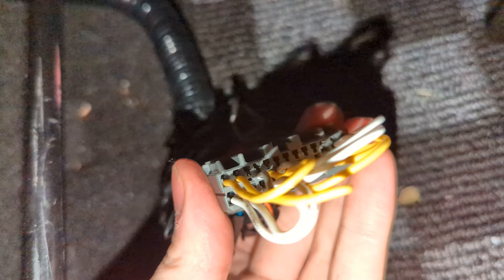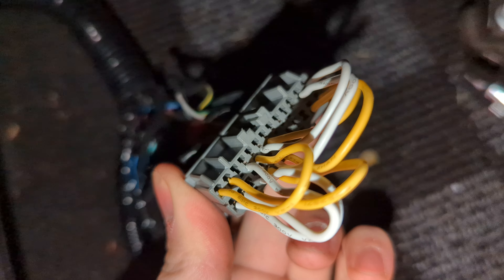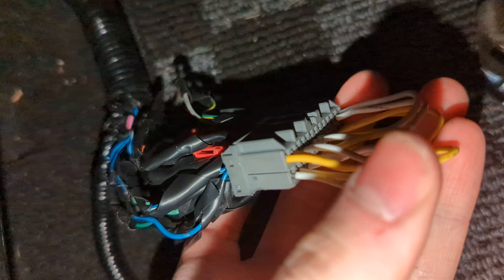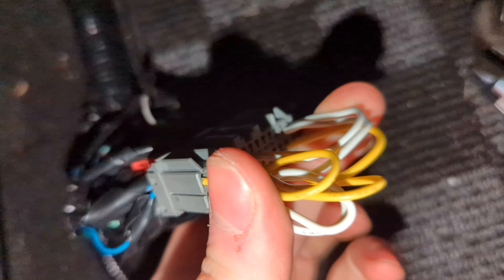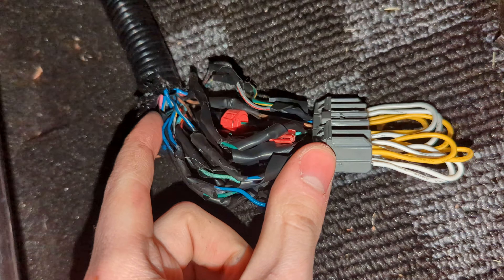It's under the seat — unplug your amp. I have 18-gauge solid core wire, and literally just stick it into the connector. 18-gauge solid core fits perfectly without moving. I'm pretty confident this isn't going to fall out. And boom — you can have your factory amp wiring be perfect and have it bypassed. And if you ever want to go back to the stock radio, literally just pull these out, plug it back into the amp, plug this back in, you're good.